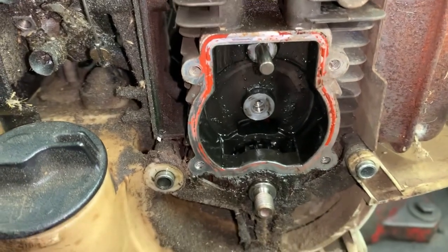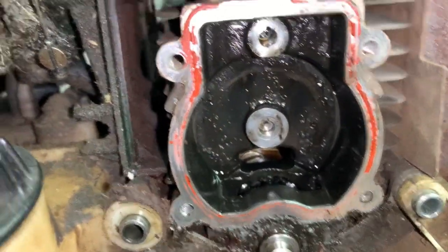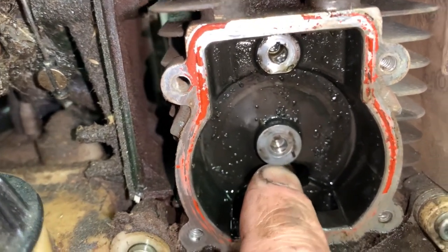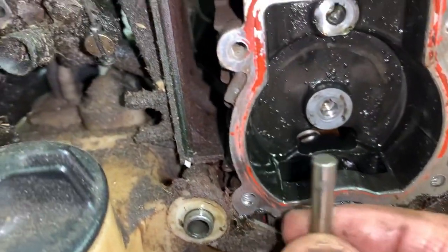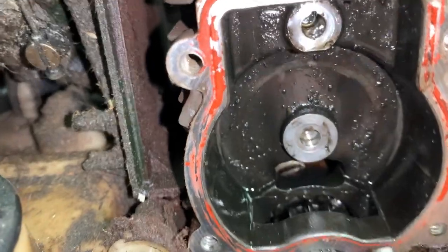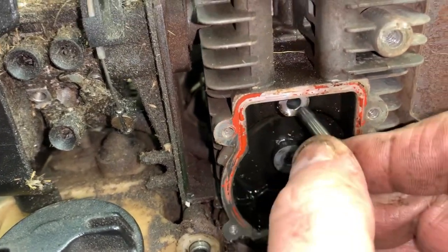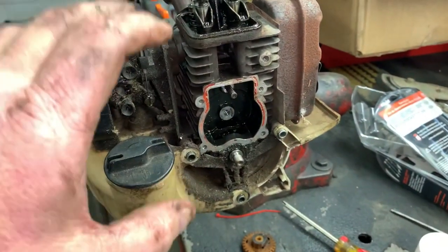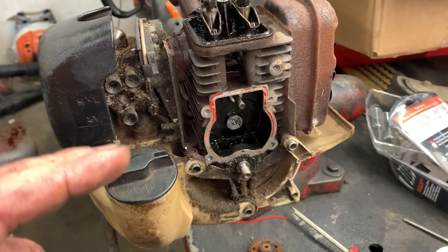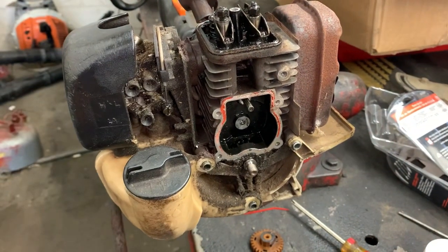I had a question on my YouTube short — what can you do to fix this? Honestly, in my opinion, you're just going to have to replace the engine block. You can take this engine to a machine shop and have them mill this out, do some micrometer work, and install an oil bushing — but by the time you do that, you could have already just short-blocked this thing. Nine times out of ten the customer is not going to have it fixed because it just costs too much. I'm not a huge fan of the 4-cycle 4-Mix engines, but when they are running right, man, they are some powerhouses — torque monsters, good running little engines when they're correct.